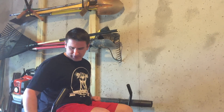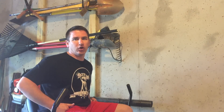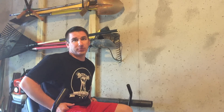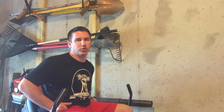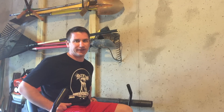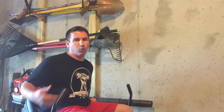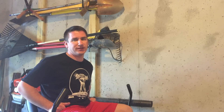The issue is when I have everything set up correctly and I turn the key, all I get is a click, which typically symbolizes an electrical issue. I did replace the battery on this mower right when I got it — I ordered a new one from Cub Cadet and had to fill it with battery acid myself, which was a new experience. I bought a couple of boxes of motorcycle acid from an auto parts store, filled it, charged it up, installed it, and everything was going great until this click. So today we're going to look at some issues that could cause this click on a riding mower. All mowers have the same type of electrical system. I'll show you specifically what I think the issue is, and we'll start by checking the solenoid.